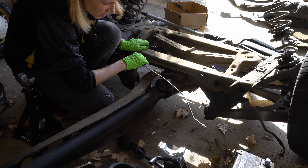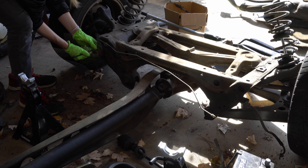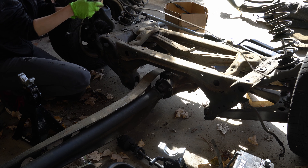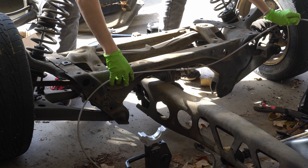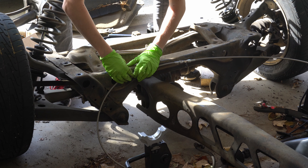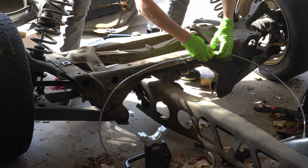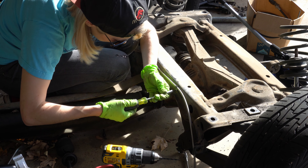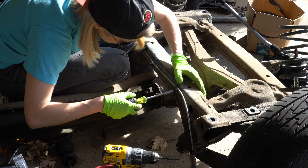Now that I have the stainless steel lines mounted to the chassis, I can focus on the rear brake lines being mounted to the actual subframe. I removed the old hard line here, and you can actually reuse these clips if you have any luck — I don't necessarily recommend it because they're old plastic. I yanked them out and ended up just drilling into this. You can see where you're going to want to mount this kind of centered here so it runs along that power plant frame. So I ended up just drilling holes next to those original clips, pulled the clips out so I had a little bit more room for the actual line itself, and just set that in place.